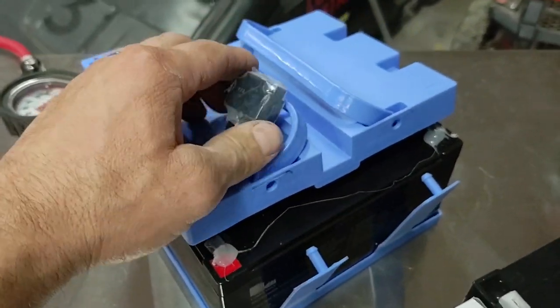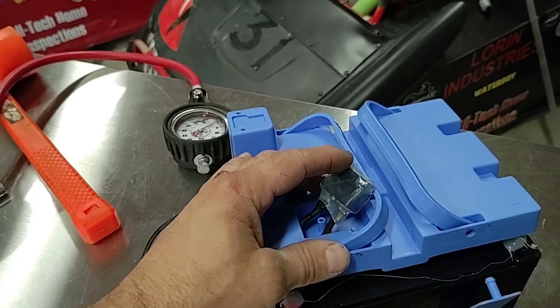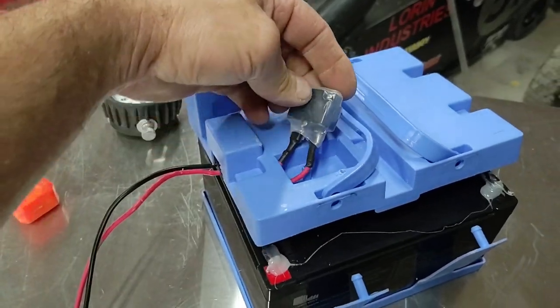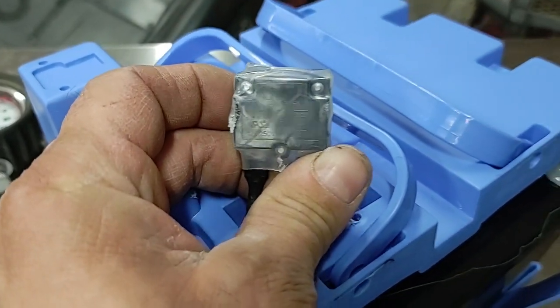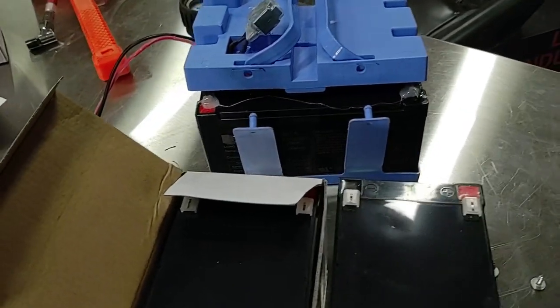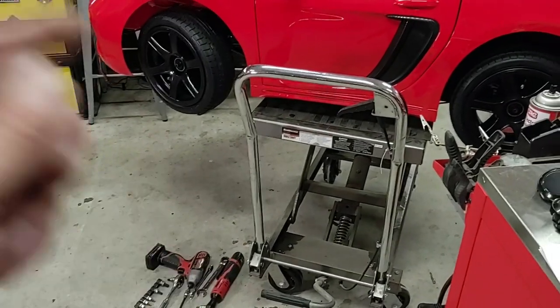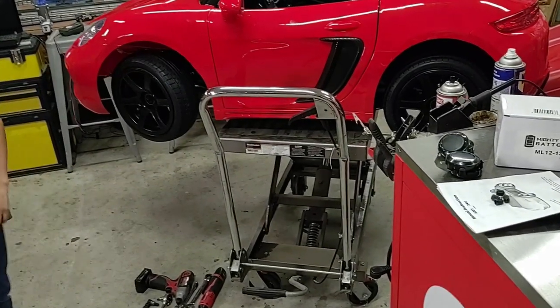The breaker concern is that the controller is rated for 20 amps but this breaker is rated at 17 amps, so it may trip if a heavier kid is riding up a hill. If it stops and then you hear a click after a bit, that's this thing resetting. They're easy to replace — just unplug it and swap in one of equal value, 17 or 20 amp. Now let's put it back together, air up the pneumatic tires — they're already feeling squishy — and take our first spin.